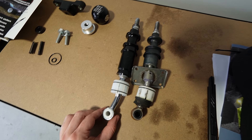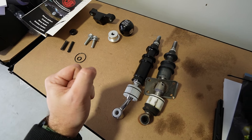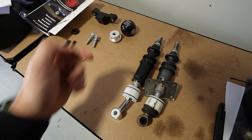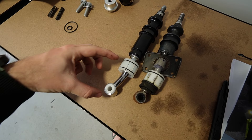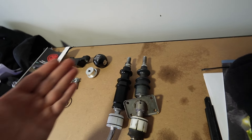In comparison to the OEM shifter, you can see that in between this bush right here is the pivot point for the shifter. What you'll notice is that on the short shifter - ironically - it's actually longer down the bottom. What that means is you have a lot more leverage on the bottom to actually shift the gears. With a standard OEM shifter, if you shift to third, that pivot point at the bottom is only moving a small amount, whereas this one has so much more movement at the bottom. That's why with a short shifter you only need to move little tiny bits. For one, it feels better; for two, it can cut your shifting times down if you're chasing tenths on the track.